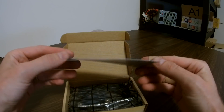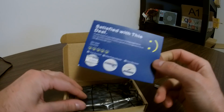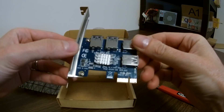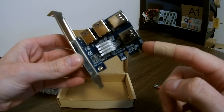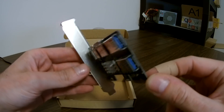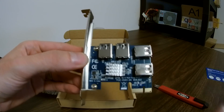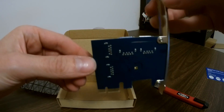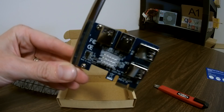This is the U-Bit brand — the same brand of PCIe riser I'm already using, and I've been very satisfied with their risers. I haven't had one issue with one of theirs yet. As you can see, it's a fairly small card. It's got one X1 slot, and then it's got four USB connectors — but they're made to connect to PCIe risers. So you can just plug four risers into it. There's not really much to it, so we'll go ahead and get this hooked up and try to plug in a fifth card.